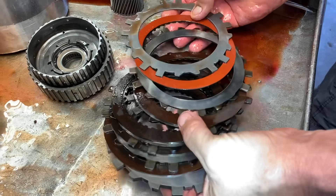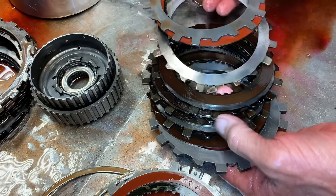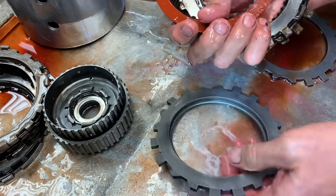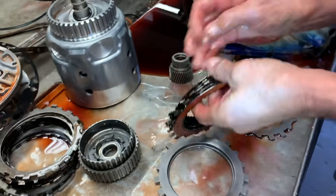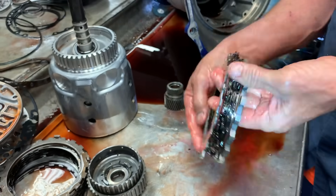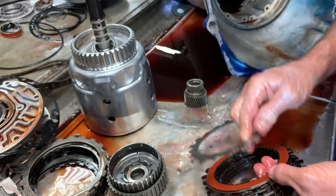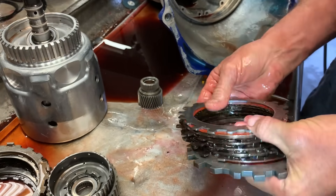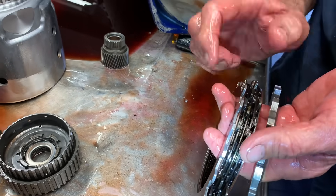This is the forward clutch that moves the vehicle forward. Why this clutch is burnt up, I don't really know until we get deeper into the drum. It's got bad seals or something. But if you look at this brand new clutch and then flip it over — you can see it just cooked it. Clutches get hotter in the center because that's where they all meet together. They left a steel out right here — they left a wave out. That's why they're missing a steel, and it's got too much clearance in the clutch pack. There should be two waves here instead of one to take up the clearance. That's what happened.